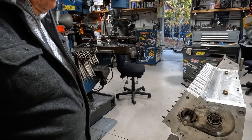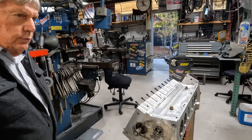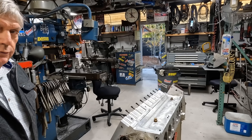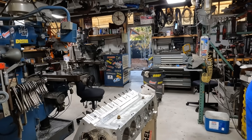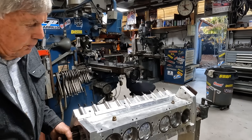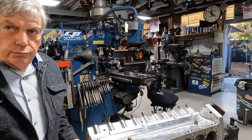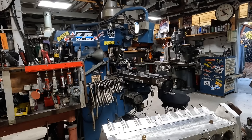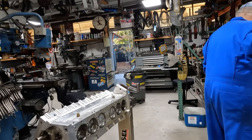So it's five liters, approximately 300 cubic inches displacement, 2.4 by 3.66, bore is 93 millimeters. With 12 cylinders, each cylinder is 25 cubic inches, where a Chevrolet is 45 cubic inches. Kevin's driving this last one home and then the bottom end is technically assembled, which is pretty cool.